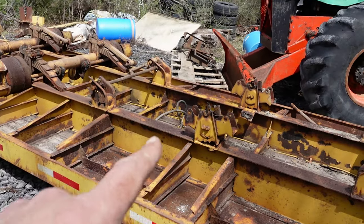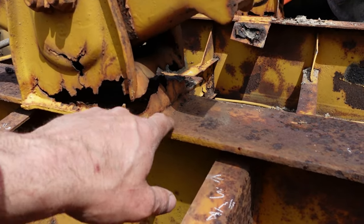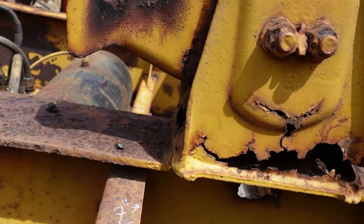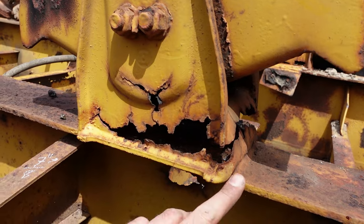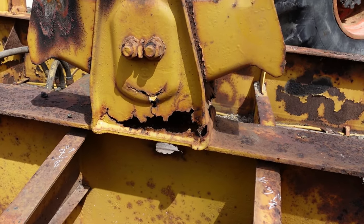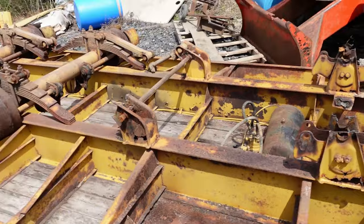But we're going to take these off. And I think the way we're going to do these, they're welded along the sides here. So three sides, this side, the back, and over here are just still a nice fillet weld. So I'm going to actually gouge that out. And this bottom edge, see, it overhangs. I might even take the torch and just slice it. I think I can get that off clean. We'll see how it gouges. Maybe we'll gouge it. Maybe we'll slice it. My gouging rod is not as fresh as I'd like, so we'll see how it runs.